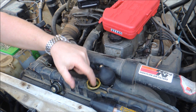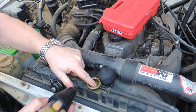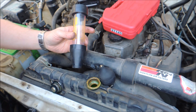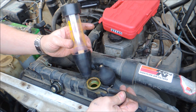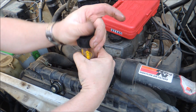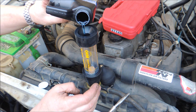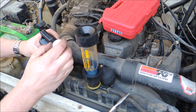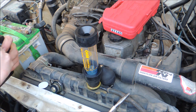I need to make sure my fluid has dropped down to a level where it's not going to suck up into there. This is actually a really small opening, so I might have to pinch off my hose to the overflow tank because I think it's going to pull air through there as well. So I'll pinch this off, insert this, and pour a little bit of fluid in here. It's a pure blue.